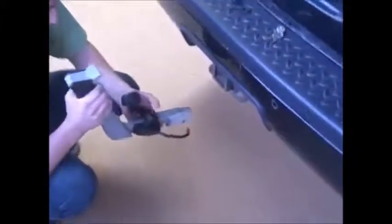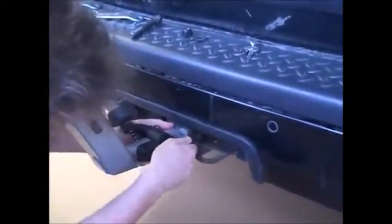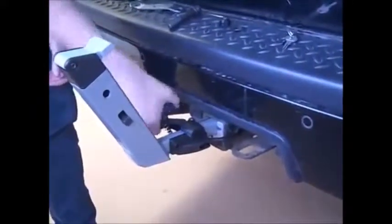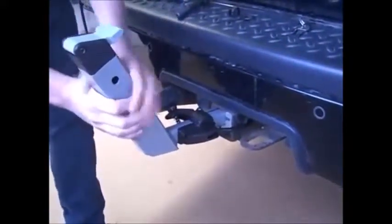To install the stinger into the hitch, first be sure the locking knob is completely loosened. Pull back gently on the auto pin and slide the stinger into the receiver. The auto pin is meant to ensure proper placement in the hitch base, so be sure the pin clicks into the hole in the side of your receiver. Firmly tighten the locking knob to secure the carrier to the receiver. If the rack moves at all, the knob will need to be tightened more firmly.